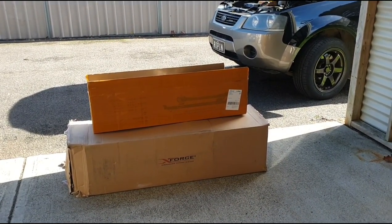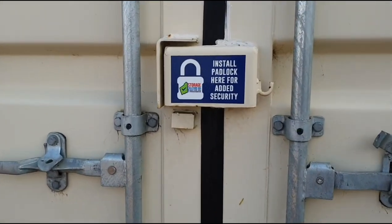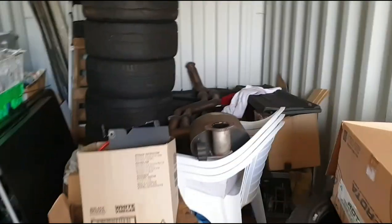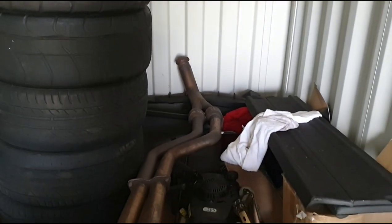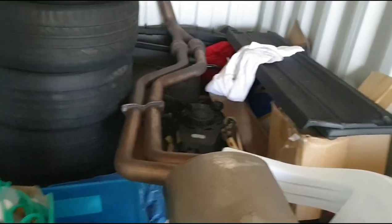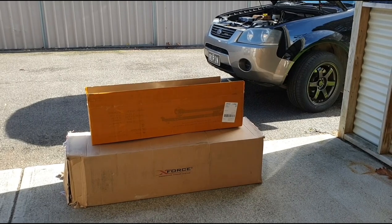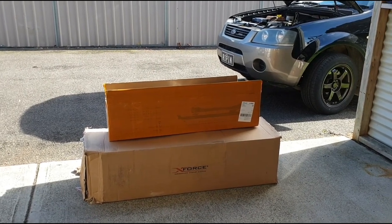I wanted to try and find a way around that. I did have my Falcon exhaust system - let's go check it out. Here we are in the storage part. Won't be needing that dump pipe, but yeah, this is the Falcon one. As you can see, the dump pipe is three and a half inch from the dump and it goes down to twin two and a half inch, but this bend here is not the same - the Territory models are much straighter in that part. I didn't really feel good about cutting a Falcon exhaust system up when I could sell it to one of my friends, who you'll be seeing on the channel in a couple of weeks.